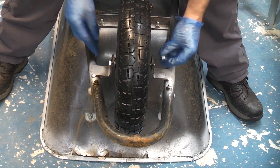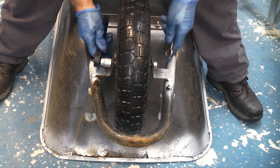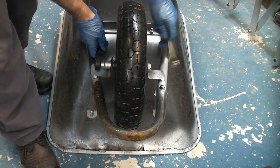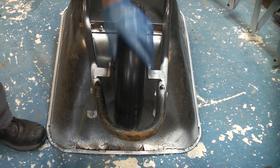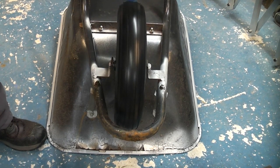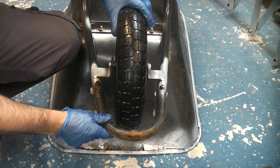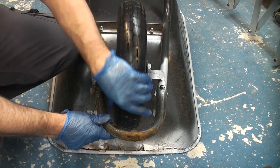I can now put the nut on the end. They are now tight and we can test out that wheel. You can see that it runs absolutely perfectly — it's a lot smoother than the old wheel we took off, obviously. That's a quick fix for a wheelbarrow. Like I say, it costs £13 delivered and it will never ever puncture again, so it's well worth spending that money so you can continue using your wheelbarrow.